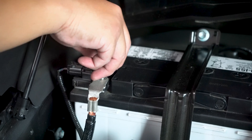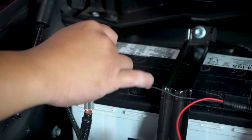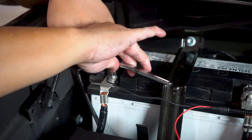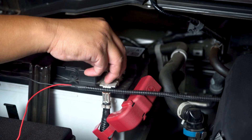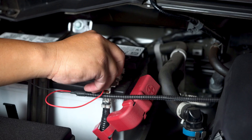The battery can be found on the passenger side of the engine bay. We will need to access the power and ground connectors on the battery. Using a 12mm socket and ratchet, disconnect the ground terminal of the battery and connect the black ground cable of the Scorcher Blue harness to the negative terminal of the battery. Then re-tighten the 12mm nut. Next, do the same thing for the power side of the battery.